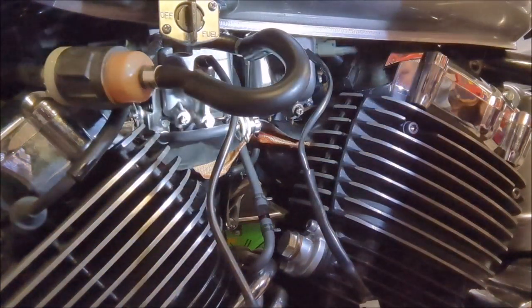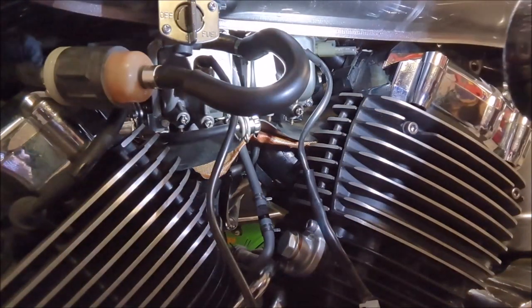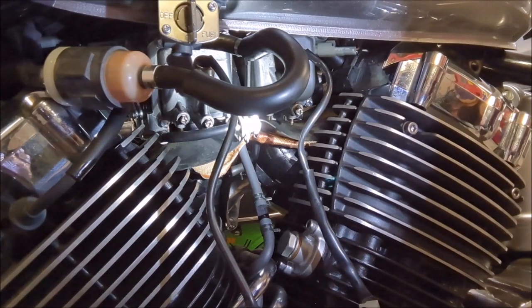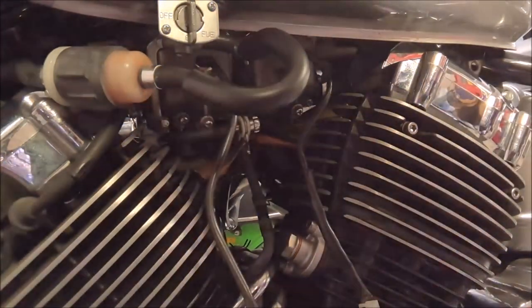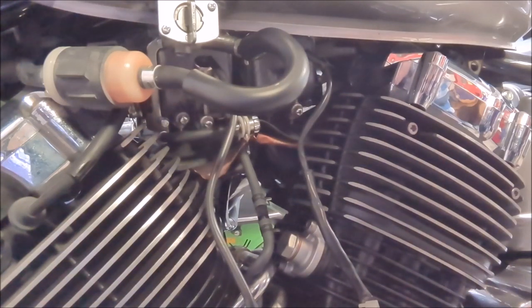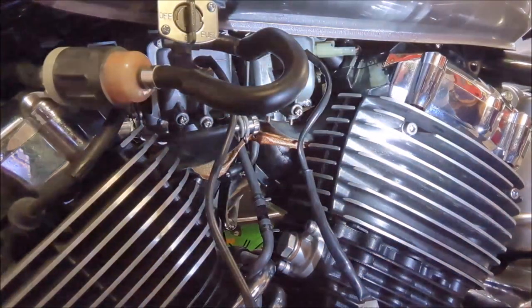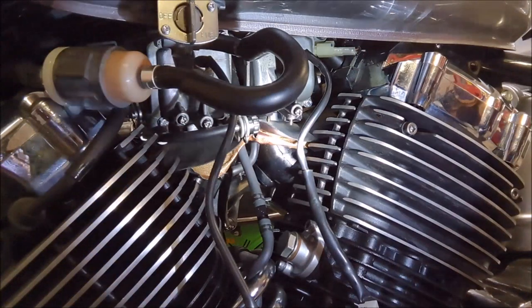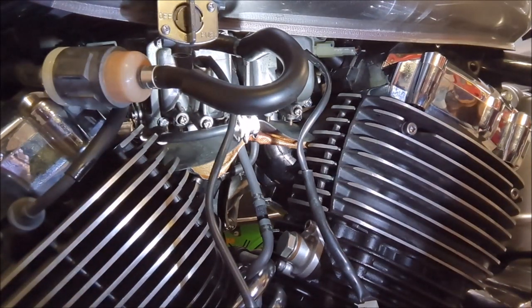Alright - we know it's got fuel. And look at that - I am seeing nothing. No drips! I think we have success. Giving it another minute or two. Believe it or not, it was just the old gaskets. That's a rare one - usually it's a needle and seat, or it can be the float, but a gasket like that is a rarity. She's been sitting a couple minutes and we've got no leaks.